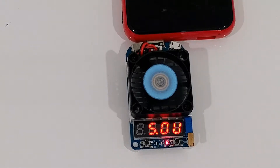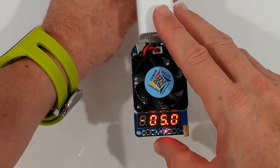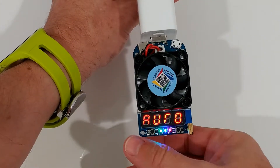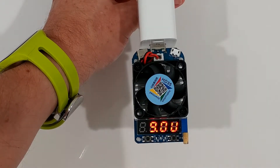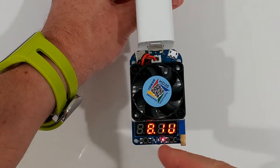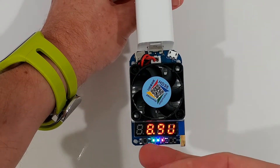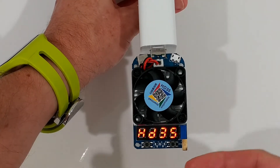Now I'm showing a different model which is able to do quick charge — a wall charger. We press again for two seconds and we're at the first setting of quick charge. We press short, and another time short, and again — now we are on the automatic mode. We press the left side once short and let it run. It needs some time to cycle through and search for different quick charge modes. You can see it goes up from 5 to 9 to 12 volts and so on, looking for what's available. At the end we see red, green, and blue lit up, indicating everything should be available.